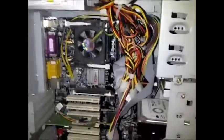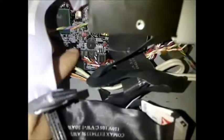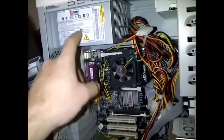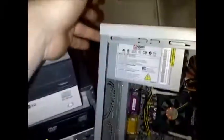If you do not have, at bare minimum, a little jump or tiny indicator lights at the bottom of your motherboard or the case turning on when you apply power, good odds it's the power supply. These things fail a lot. They're really easy to change — just four bolts on the back you can take out with a Phillips head screwdriver.